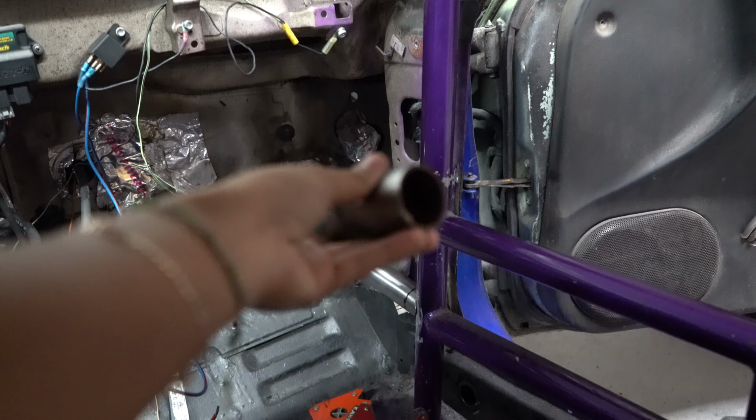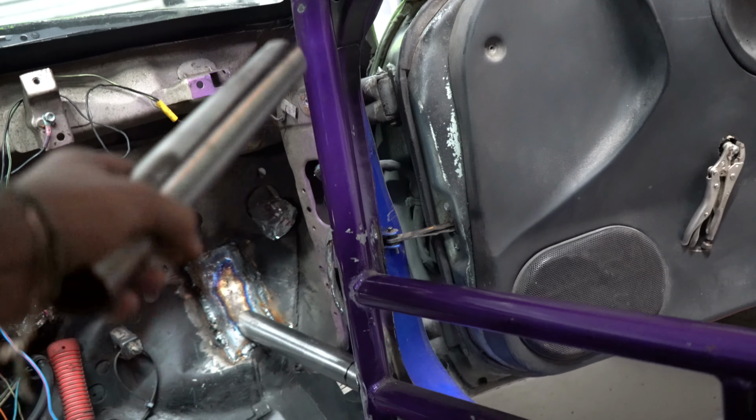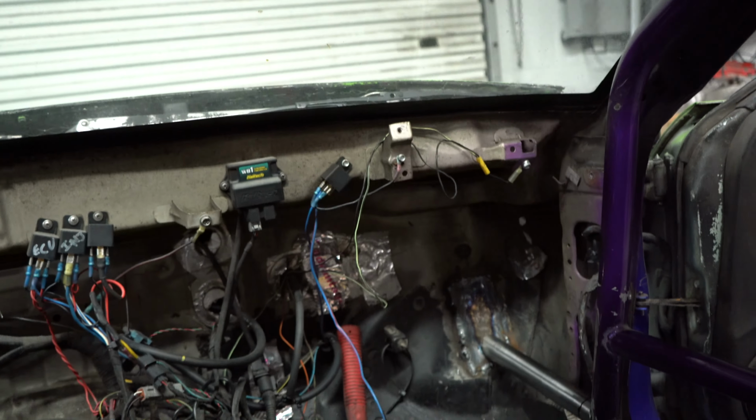Intrusion bars didn't get done. It was a Juke, right? Yeah, it's a Juke. It's a really old Juke cage, but the newer techs for the cage are different than what the cage came with, because the intrusion bars for these are so much shorter that they would only go from about there down to where it meets. But we gotta get the bar going from up there down, like the picture shows. So he's gonna have to make new bars. Not that big of a deal, but just a little extra work.